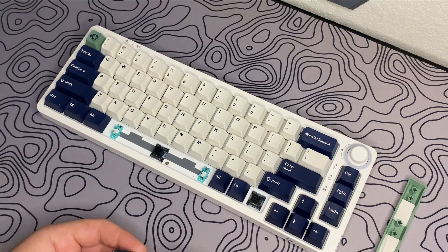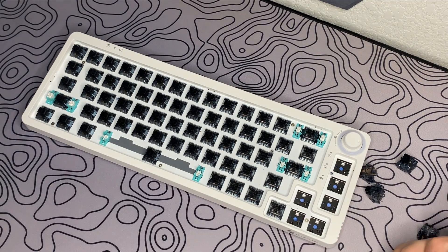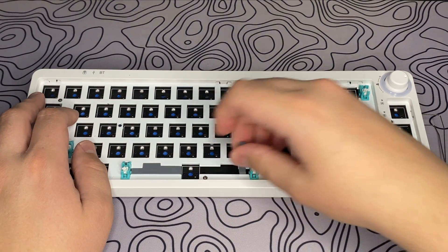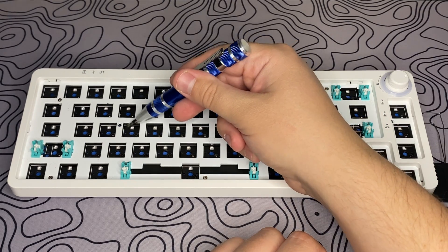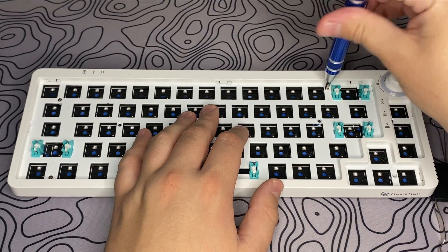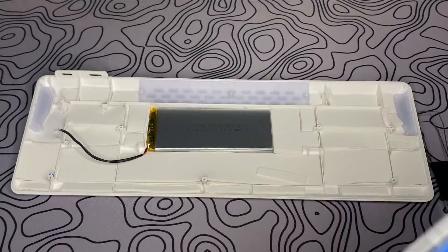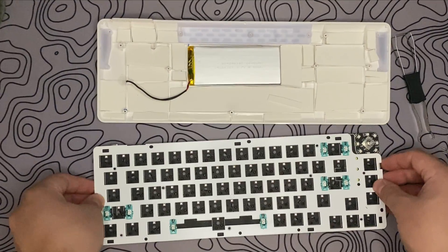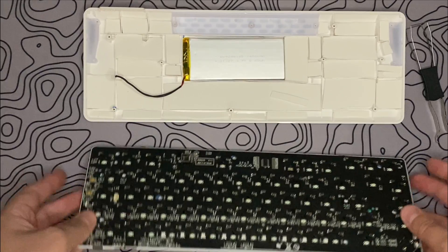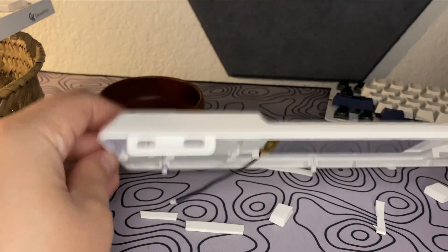I could sit here all day pulling off these keycaps, or I can snap my fingers. I could take off each switch, but I can also snap my fingers for that too. I'll be removing any variables, including the two rubber sound dampeners for the spacebar. I also modded this keyboard following another Keyboard video — clipping out the middle standoffs, which creates a top mount mounting style. I'll try to save the tape mod for next time. If you look closely, there is foam in between the plate and PCB. I'm just testing to see if each material produces a different sound, not building a perfect-sounding keyboard. I also got to remove all this EVA craft foam — if you want to hear the sound test for that one, I'll drop a link in the description.